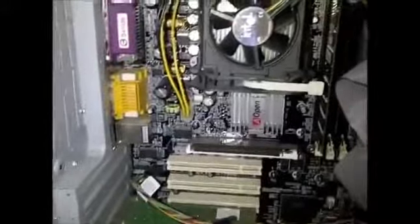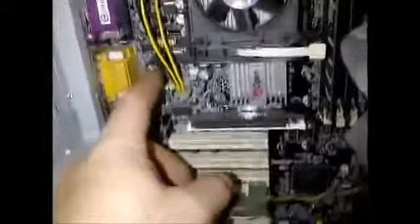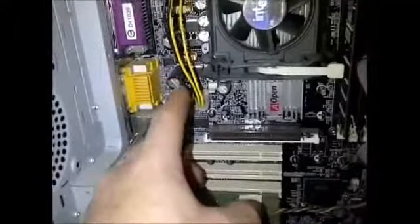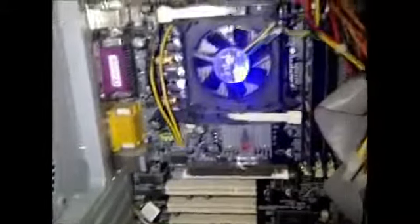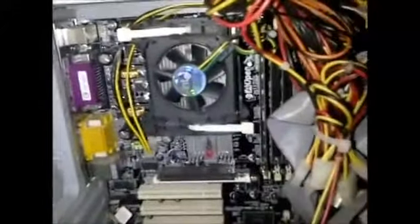There are a few down here, but usually these types with the X's on them — if they are swollen or leaking, that means you have a bad motherboard. You can actually replace these caps. If you get another one of the right value, you can solder a new one in. Usually you replace all of the type that are bad, and that will fix your problem.